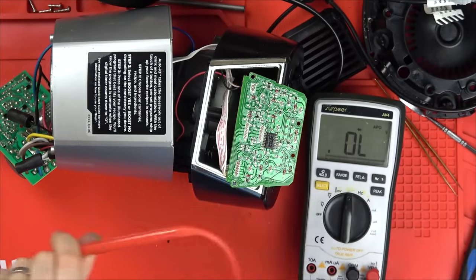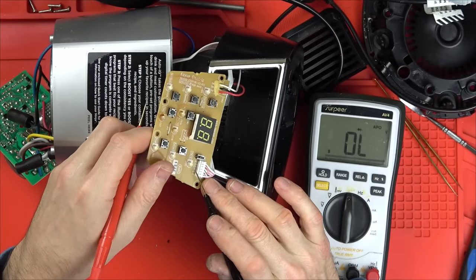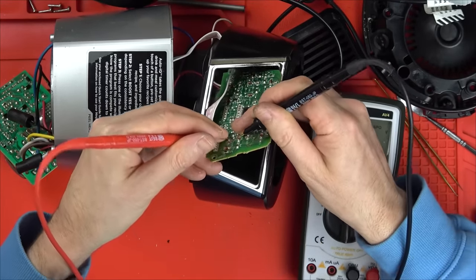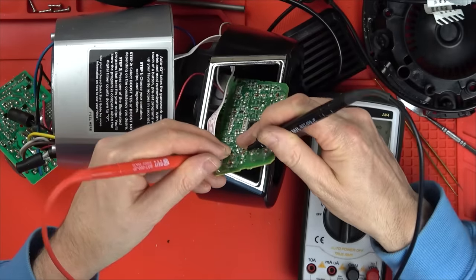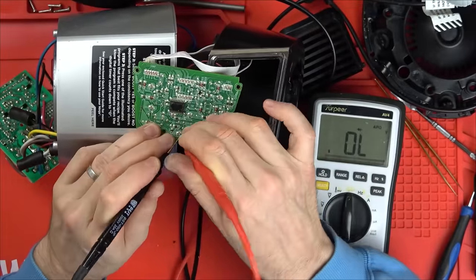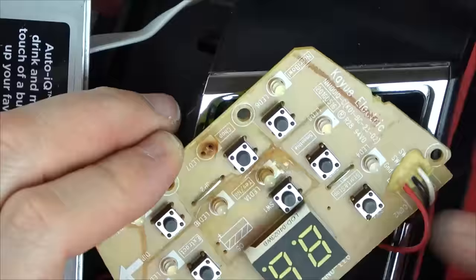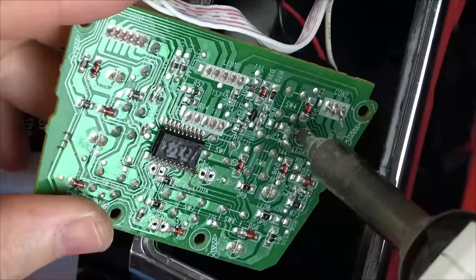Let's see one that's working - I think the pulse did work. I want to go across here to see if it lights up - no, that didn't work, it's probably because it's in circuit. So I can physically see that the LEDs are rusted, but the board itself looks very good where all the components and traces are. I don't think it's a case that the traces have been eaten through - it just looks like the LEDs themselves have rusted through. So I'm going to use my desolder station and remove the four faulty LEDs and see if they read anything out of circuit.